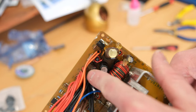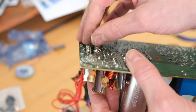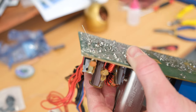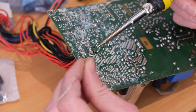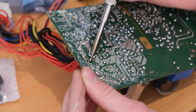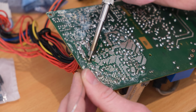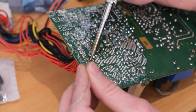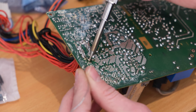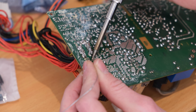I learned this from Volta, who mods those consoles. The hot glue just sort of melts right off, so you can pick away at it and let it soak in. It's a really safe way of extracting the hot glue from those components without pulling on them, because you can often pull other things around them out and damage them, since the whole thing's sort of glued together. But other than that, it's just more capacitors and components, and then good to go.